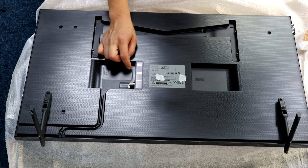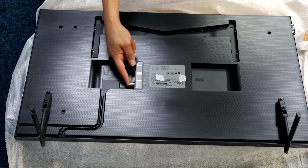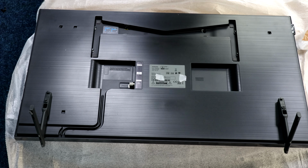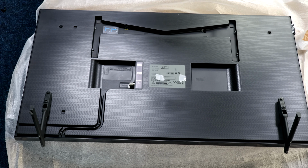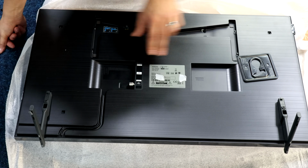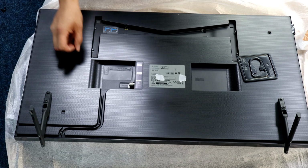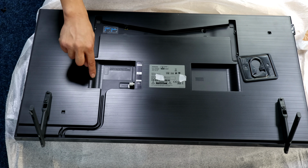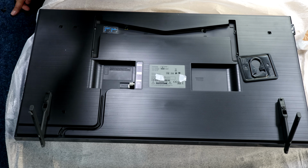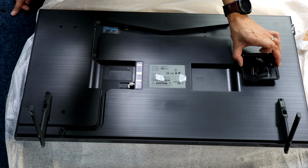While we're looking at the back there, we can see where the OneConnect cable goes into that socket there. And the only downside, I think, on this is the aerial doesn't go into the OneConnect. It goes direct to the TV. Downside I can see being that if it's on the wall, it's such a small gap, your cable's got to come out of here. So if you did have a hole with your cables coming out the wall, you really need to position your hole so it's straight into this well here and into the socket, which could be a bit tricky because obviously you can't have excess cable behind unless you space these off the TV.